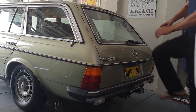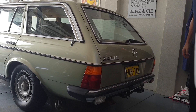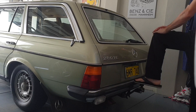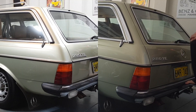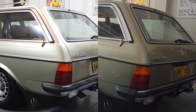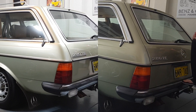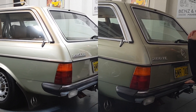So this is afterwards. I haven't run or driven the car yet, and I think it'll soften up even more, and I haven't topped up the fluid yet — but you can see there's damping there now, it's not bouncing around like a trampoline. Here's just a comparison: I'm bouncing up and down a lot on the left side, but you can see from the shadow when I stop bouncing how much spring it has in it.